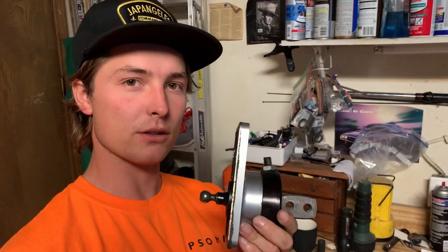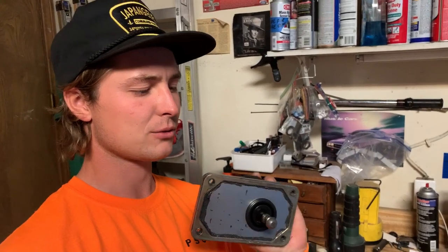It's just weird. So I watched the how-to video on how to put a short throw in, so this is a Hurst Ford Performance T5, T45 shifter. So the guy had put it on this before, he put the spacer that's only supposed to be used with a T45, not a T5. So I mean, I don't know what that could do, having a what is it, a 16th inch spacer on your transmission with the shifter. I just know it probably isn't good, so that's a bummer. Maybe that's where my vibration was coming from in the shifter, so I don't know.